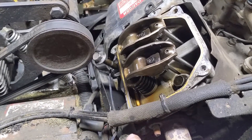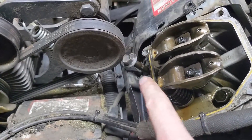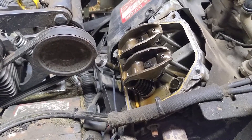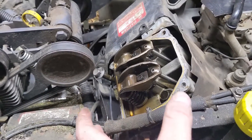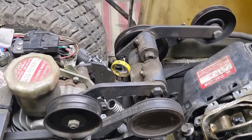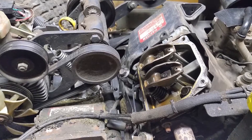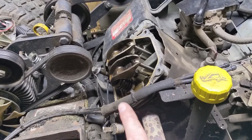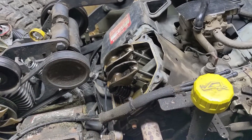So I've got all my head bolts loose and I have this one here removed — that was just affixed under the bolt so I don't have to unplug it. The bolt down here is hitting this pulley but it comes up far enough that I think all of the threads are out, so I should be able to pull the head out without having to remove this whole pulley system. When I'm ready to reinstall the cylinder head I think I might be able to put the head gasket onto the cylinder, put the bolt through, and then lower that in all in one piece.